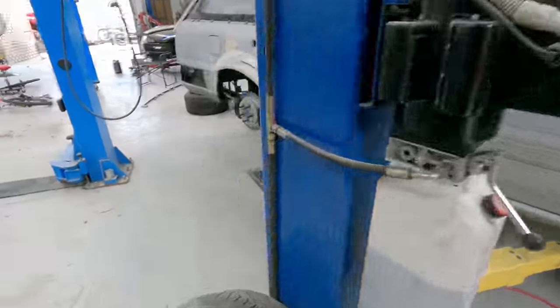The diff is back in which is good. Got the new braided lines moved a bit more out of harm's way. Got new arms coming with rubber bushes for more flex. The diff guys have bent the diff and put a chamfer on the axles — added a degree of negative camber each side to help create more side bite on entry, giving a flatter contact patch on the tire. Shook the toe out — before it was one and a half to two mil total toe out, now it's going to be zero toe or a little bit of toe in. Jason's got R1 tires instead of R4s — Eknova's 140 treadwear instead of 240 treadwear, they'll be hooking up.